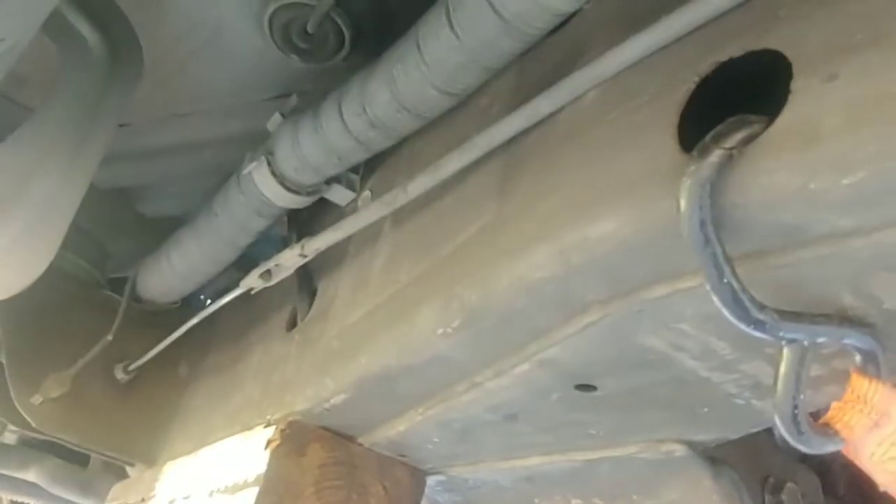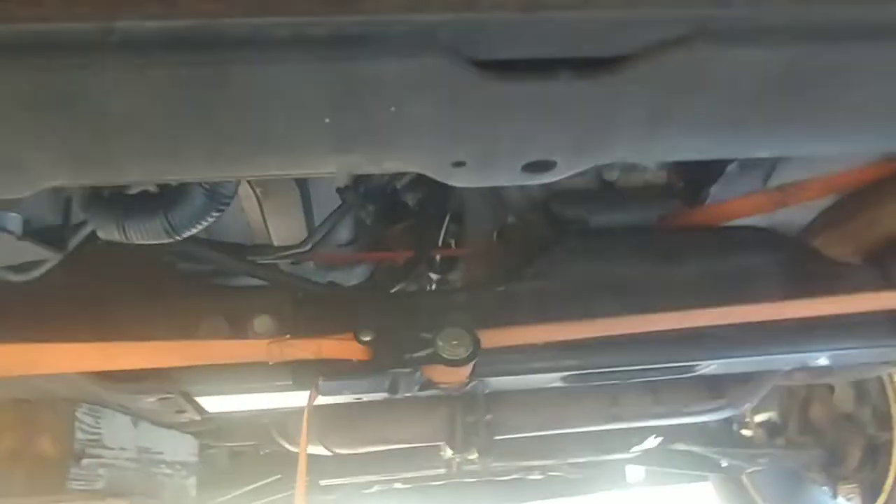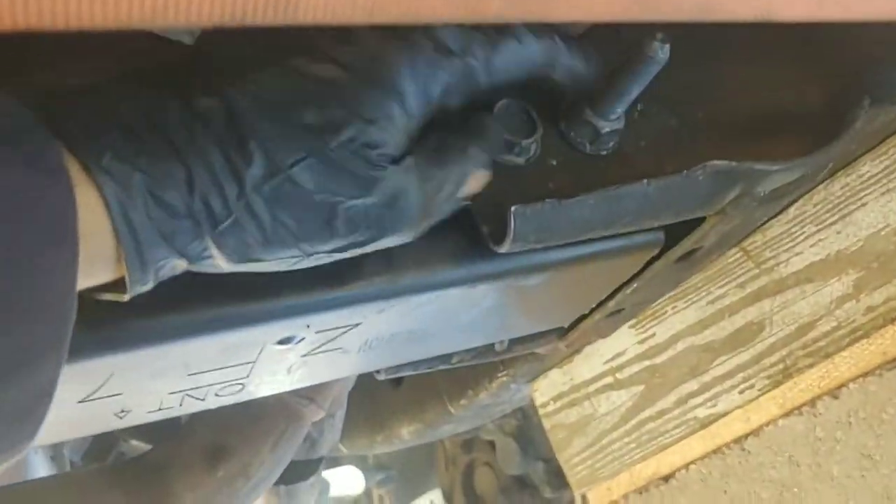You see, we're anchored on both anchor points on the driver's side, outside edge of the frame, going around the transmission on the bottom to hold it — because we're about to take that out — up on top of the frame, wrapping around, and secured just like that. Take out the 15mm nut that's holding the back of the transmission to the crossmember. If you don't have deep sockets, you're not going to be able to get it — this one is 13 sixteenths right there.